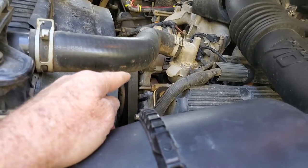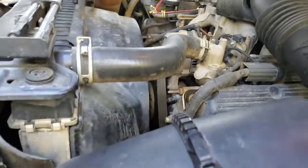The one that was in here was really bad and I ordered a new one — and that's the first thing you've got to make sure of. I know how to do this because I've already done it a couple times. When you order your new belt, there are two kinds: one is longer for trucks that have air conditioning, and one is shorter if you don't have air conditioning. If you just say 'I want a serpentine belt for my Triton V10,' they give you the short one. I went to Napa — he didn't ask me if it had AC, asked the questions on his screen, and sold me the wrong belt. So make sure you get the right size belt.